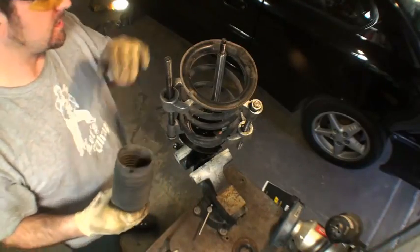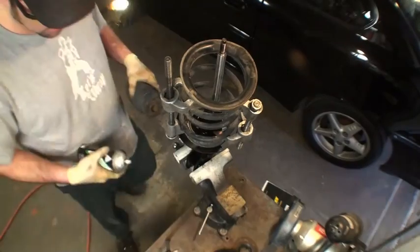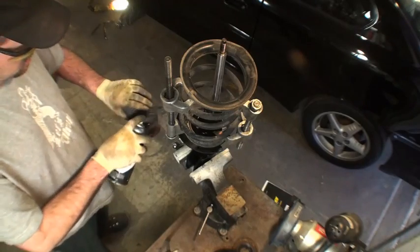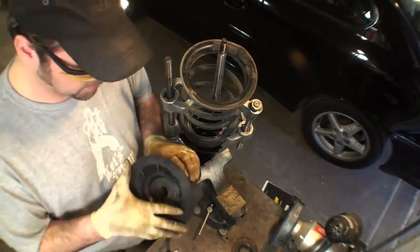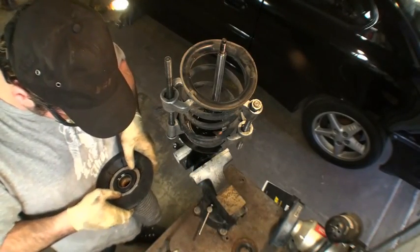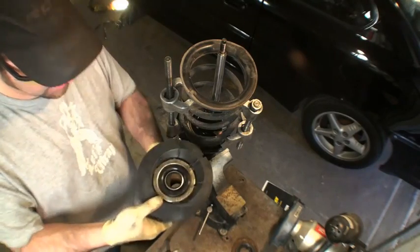Inside here there's a rubber bumper. That's important, because if the strut ever bottoms out, like you hit a really deep pothole or something, that rubber bumper is going to help protect everything up there. This looks like a job for lubricants. When I'm trying to put rubber stuff together, I use silicone spray. Everything goes together better with lubricants. Take the new bearing assembly and put it in. I don't know if this is going to... yeah, it is. Push down in and be held together.